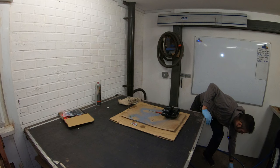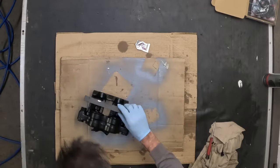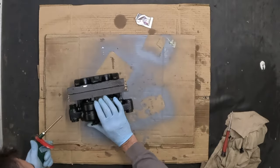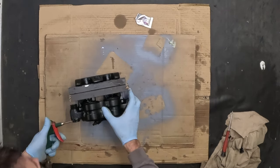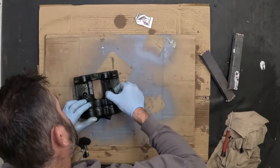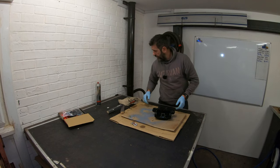I'm just going to get my air gun again and draw out those pistons. The rubber gaiters are fully on and appear to be locked in on the other side — then push them back in. Next stage: the slider.